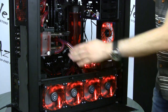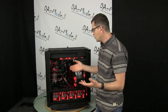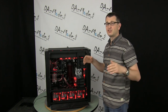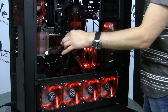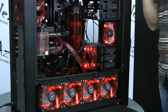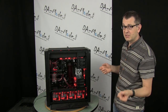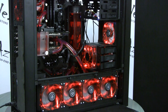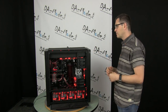The second problem with this build is that it's using only straight connectors - no angle adapters whatsoever. It's compression fittings with nice tubing, but all bends are done just with the flexibility of the tube. In certain parts it stretches almost beyond the limit. For example, the tube coming out of the bridge between the cards and going into the motherboard block - you can see the tube is bent so hard it's almost collapsing. The client was lucky to have 3/8-5/8 tubing with almost 3mm wall thickness - it's really hard to collapse, but it's almost collapsing. With thinner 7/16 or 3/8 half-inch tubing with just 1mm walls, it probably would be collapsing by now, and that can cause overheating.